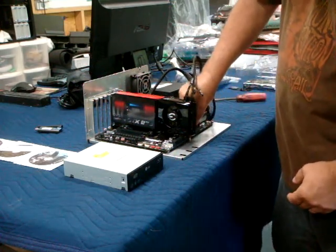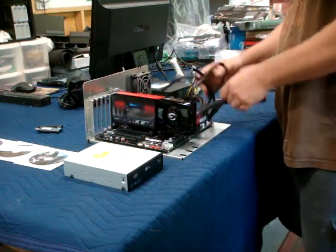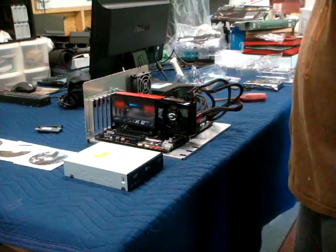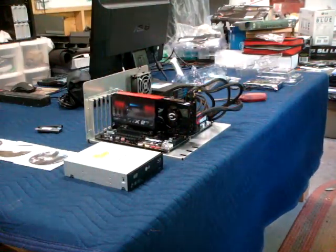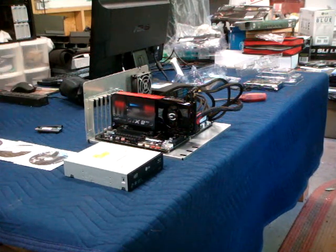At this point, we can light off the board and see it in BIOS, which is what I like to do before I even get started with putting peripherals on it. Because if you put on the hard drive, optical drive, the NIC card, the sound card, everything else, and then it doesn't fire off, you'll be like, well, which part is it? So fewer parts the better, really.